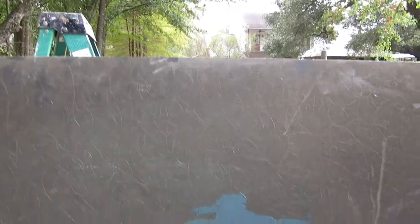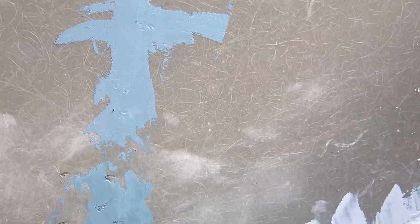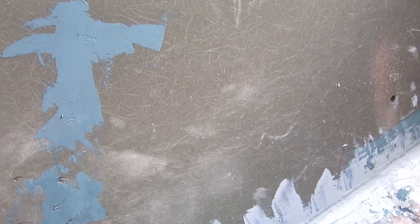And then I'm going to start fiberglassing the transom at least high enough so I can put the stringers in so I can put my deck down. That's my goal. I don't want to go all the way to the top because I don't know what I'm going to do at the top. I want to put like 7 layers on it, so I'll probably put a layer, a layer, a layer, a layer, a layer, a layer, and get at least 5 where the stringer is going to go, and then put in the stringer, and then maybe put in a couple more.